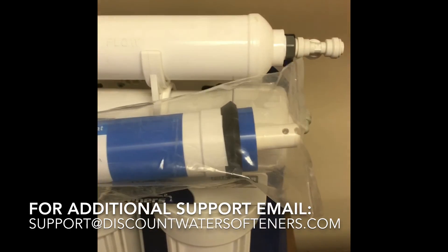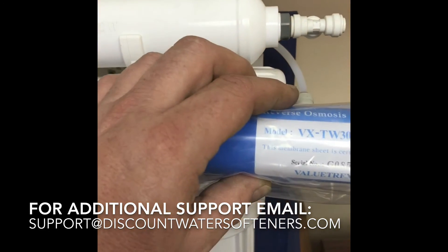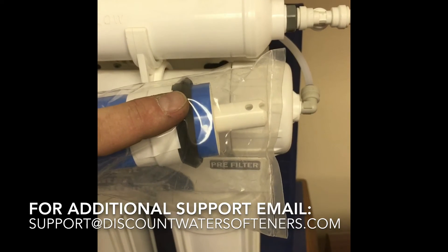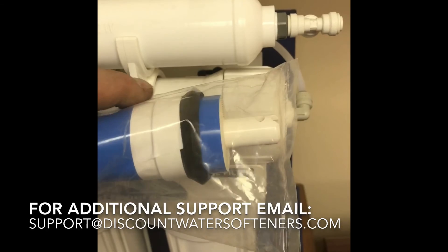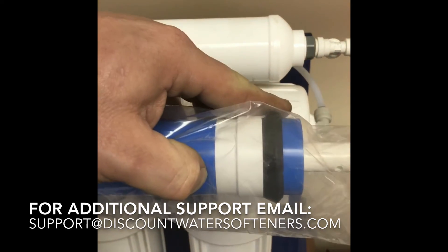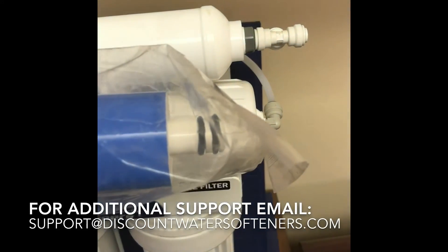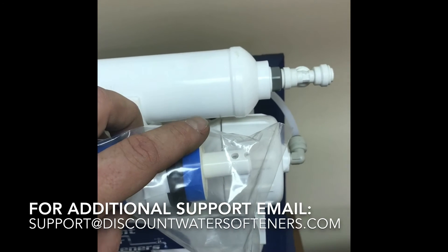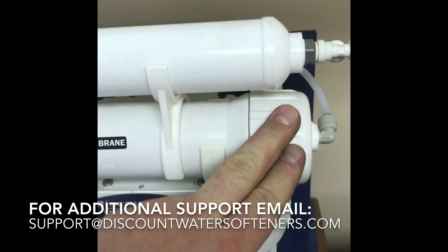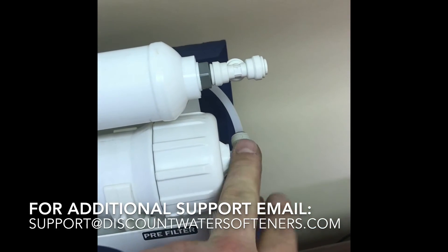When you take the old one out it's going to look much like this one. Use a pair of needle-nose pliers to pull the stem out of the housing, then put the new one back in the same way with the seal on the right-hand side. If it does not go in all the way and you cannot close the cap, turn the membrane and push in at the same time — you'll eventually find the groove. The end with the seal goes into a specific groove, and then you'll be able to get the cap back on. Make sure the cap is tight and the rubber O-ring is in place, then reconnect your fitting on the end.